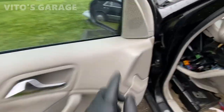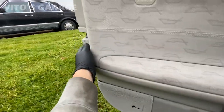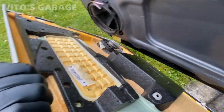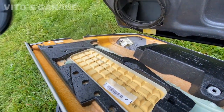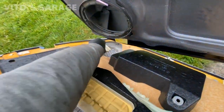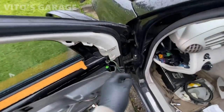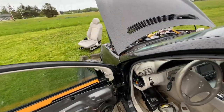I'm about to take this panel off — it's cracked and broken up. Got the door panel out. There's some interesting stuff going on here — someone has definitely been here before. I'm going to have to re-glue some of these door panel mounts. The speaker also came off the door panel — it was just laying there strangely. The door actually looks really good, just needs cleanup. There's a wire here that goes to the mirror — the draw is still 0.11, so it's not the mirror.